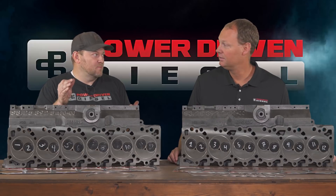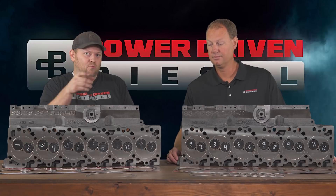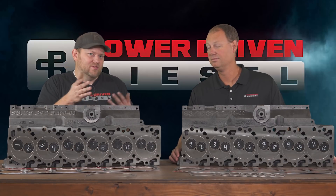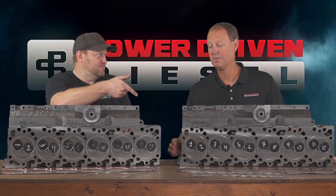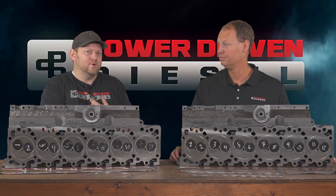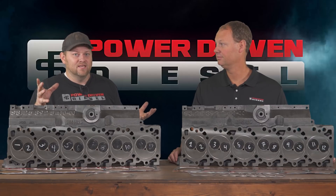Talking numbers: an o-ring is 41 thousandths and sticks out 10 to 15 thousandths. A fire ring is 105 thousandths wide — much wider — and it's not pushing on a factory firing, it is the ring. The groove is cut about 120 thousandths wide and generally about 40 thousandths deep if it's all in one surface. There's a lot more ring, and it also has to take up the space of the gasket, so there's more crushing happening. In the past, fire rings were thought to be less reliable because after 20,000 street miles they'd crack from heat cycles — but that was with square grooves. Radius grooves fixed that problem.